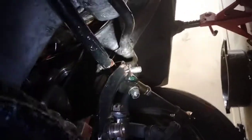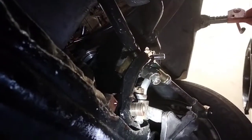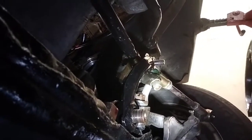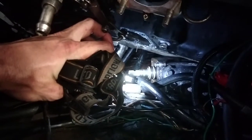This is what I'm dealing with — this is on the other side of the power steering pump. I thought, okay, I'll just pull this arm off. That's what the book says to do — pull the arm off and then remove the pump from below. Well, both of these joints here are pressure-fit, tapered onto their bolts. I've got a flywheel puller and I can't get that flywheel puller behind enough of this lever to get some purchase on it. I didn't really want to touch this pump because it's however old and it didn't leak — the moment I touch it it'll start leaking like a sieve.